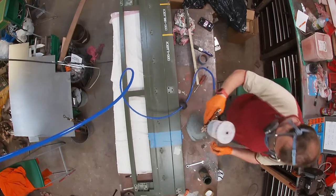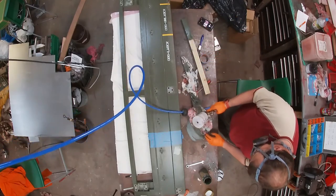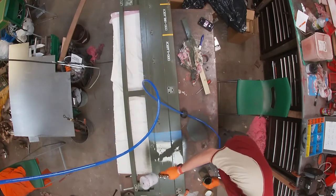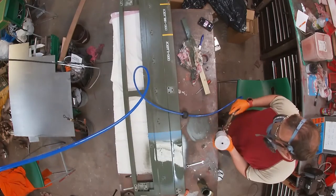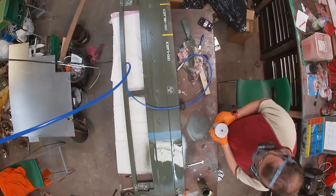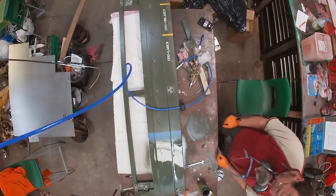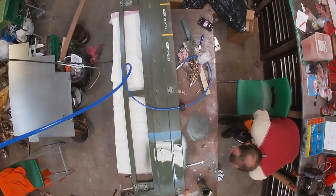I'm going to put it in the pot. We'll have a bit of a test spray - it's coming through, so we'll just see how it paints. It looks like it's got quite a good shine to it for being a satin. I'm told not to use matte paint because matte paint is porous and therefore will let water through and let the panel underneath rust. So that's apparently a big no-no to use matte paint.